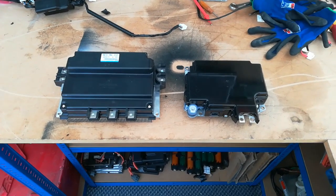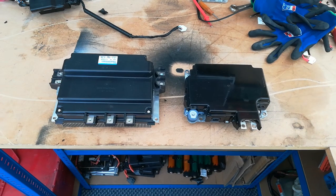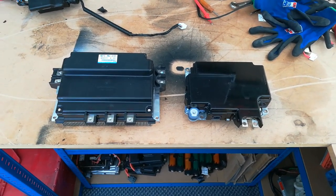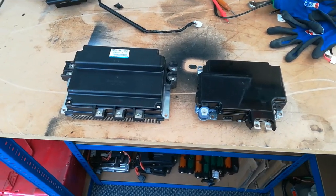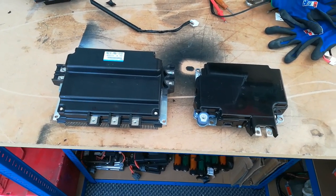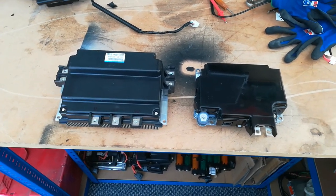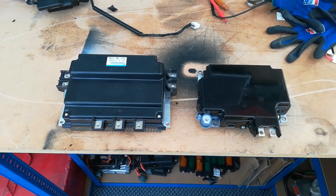The project currently is to make a higher voltage capable CRZ control setup and then make that work with a lithium polymer minimum sort of like 200 volt pack made up of the Accord cells in a 50S2P configuration. To do that I've had to basically cannibalise a lithium OEM pack and a nickel metal hydride OEM pack.